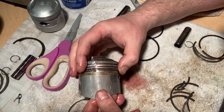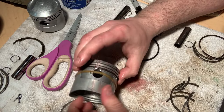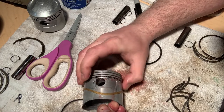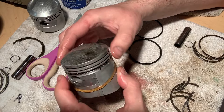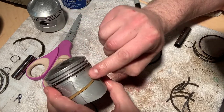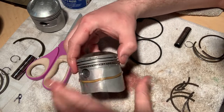Let's work our way around it. I'm going to hold that ring and then pull that out. Now we got one more to go. I'm going to line this up again, be really careful on torquing these rings. That's nice and smooth, that's spinning. Now we've got to go ahead and put the top in. I want to double check that seam in that oiler ring to make sure that my seams aren't lining up. You don't want your gaps to be lined up on the different rings - that's really, really important.